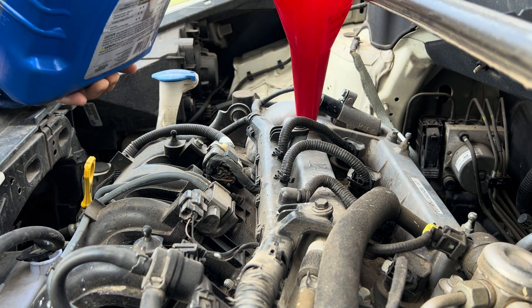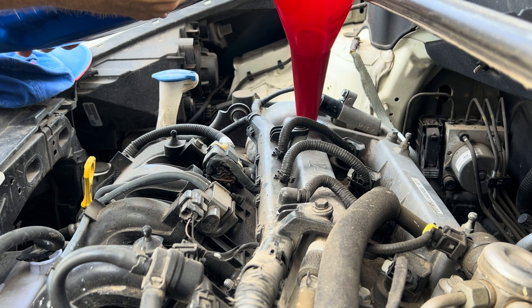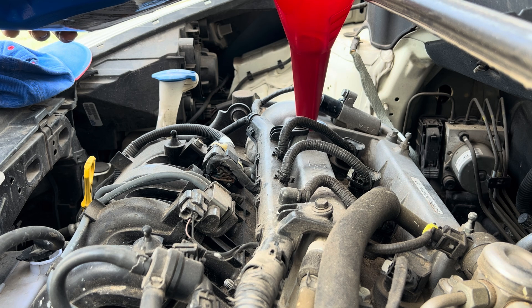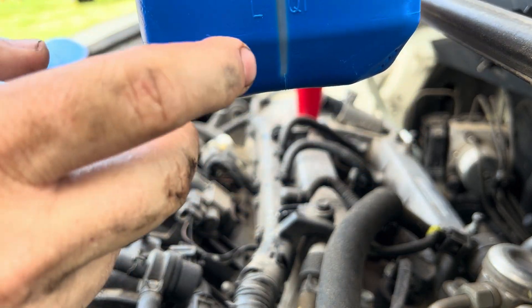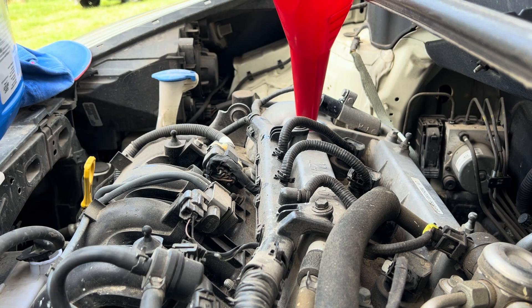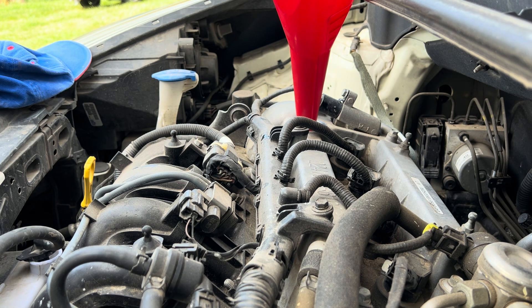I'll show you where I took the cap off the engine — put it up here for safe keeping. This engine's oil capacity is about 4.5 quarts. I don't know why manufacturers do that — a lot of them will, whether domestic or import — so you end up with a half quart extra you can keep in the trunk to add later when the engine burns some. You don't want to use all 5 quarts to fill it up; you don't want to overfill an engine. Sometimes that'll blow gaskets out and cause damage. Most oil bottles have a gauge on the side — I've got a little over a half quart left, so I'm going to stop there.